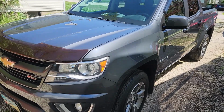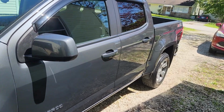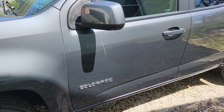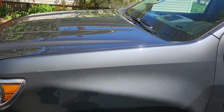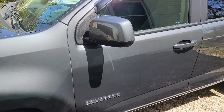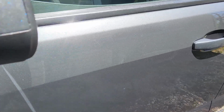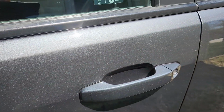Finally all done. Good thing this is a friend of mine. Did the Urofiber 50/50 instead of the yellow and then red combo. The Urofiber on the 25mm cleaned it up real nice. There were a bunch of dog scratches right through here from his German Shepherd, who likes to get in the car. They're mostly gone now.